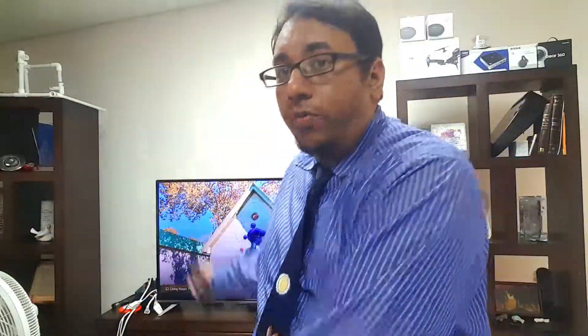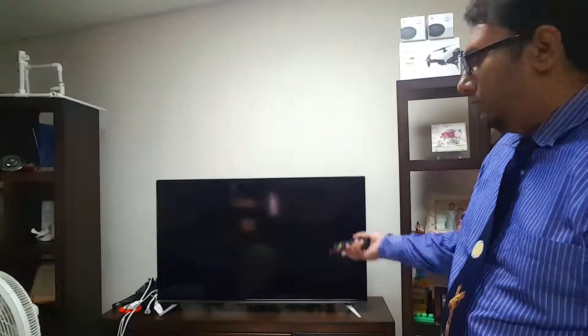What's really cool is that the Google Chromecast, because it's Wi-Fi, means you don't need to purchase a separate smart switch — the Chromecast itself acts as the smart switch with the CEC function. I can tell my Google Home: 'Hey Google, switch off living room TV,' and the CEC function activates. The Chromecast is connected directly to power and always on in the background, listening for commands. It sends the signal to the HDMI port on the TV and switches it off. Similarly, saying 'Hey Google, switch on living room TV' turns it back on.